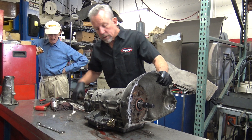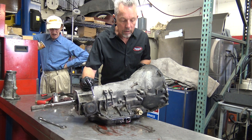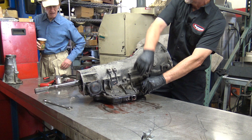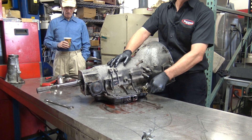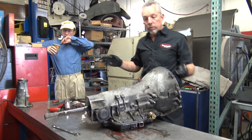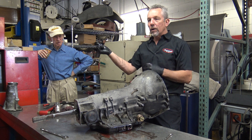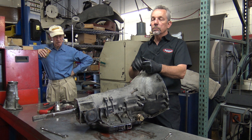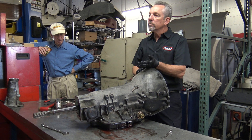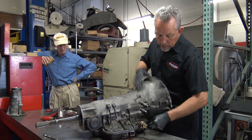What I'm going to do now is pull off the modulator — it's a vacuum modulator. What it does is it's hooked to a valve. This is what tells the transmission, aside from the torque applied and the pressures inside, when to shift. It's hooked to a pipe that's connected to the intake manifold on the car. When it's idling or you're on a coast, it has super high vacuum because it wants to pull air all the time. When you open the throttle it pulls in as much air and fuel as it can get. When you're off idle you're choking it down — like putting your hand over the end of a vacuum. When it's running it sucks your hand — that's vacuum. So that tells the transmission how much load is on the car.